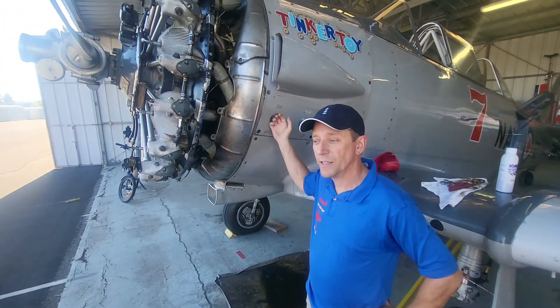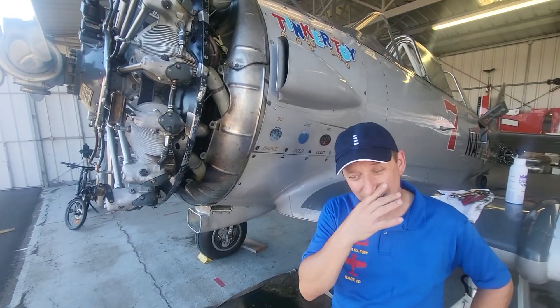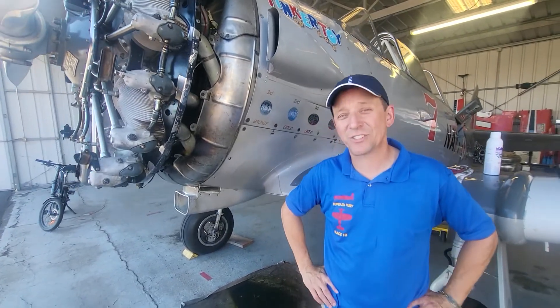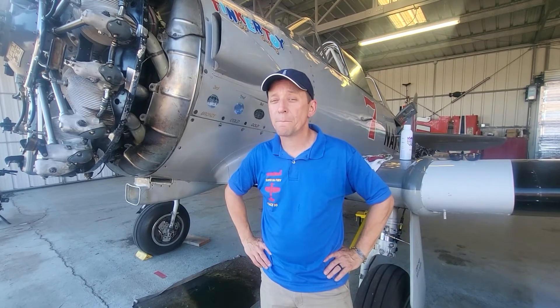The real question is: how much of an effect does removing the air filter from the intake help in racing? I'd guess 10 horsepower, maybe more — could easily be 20 to 25 horsepower. This engine makes about 600 horsepower stock; that's the official number. In racing, we figured about 900 horsepower, so you do all those little things to try to get there.